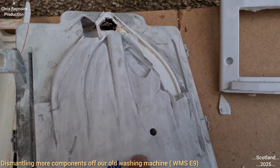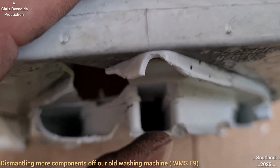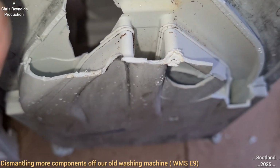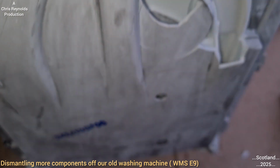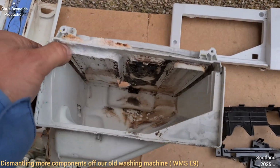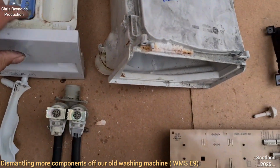Come through these channels, as I explained earlier on, to get the softener to work. Both jets come on at the same time, causes the water to go through that centre channel. There's no valves or flaps or anything that direct the water. It's just done by crashing the water together to form a centre water jet. Go through there to wash the softener down into the drum of the washing machine. This is the soap dispenser main housing. This is basically a demonstrator, just pressed down on that to release it.